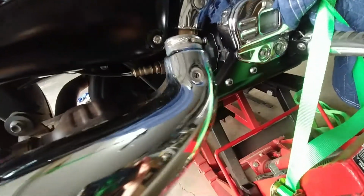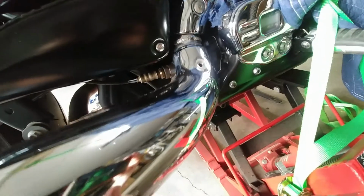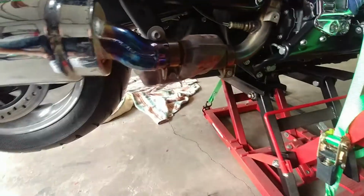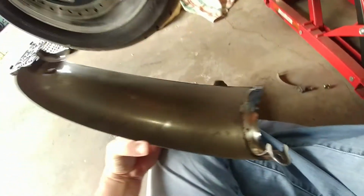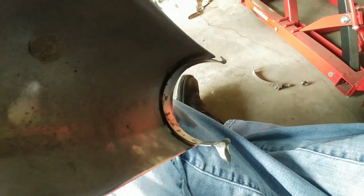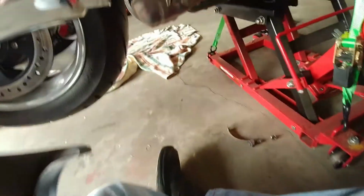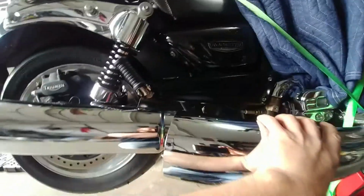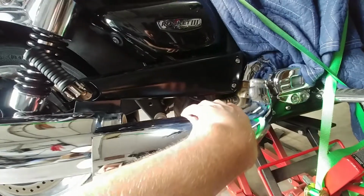It's noisy and squeaky, but the steps are you slide this tip underneath the chrome, right under here, underneath the existing piece of heat shield. And then I figured I'd want to show you guys this because it was a little confusing the first time. First things first, I said this in the other video, but this is the back side of the heat shield. You can see it's got a bit of a clamp to it here. That clamp just snaps over the smaller part of your muffler there. So let me get this back here. You just shove it over once you've got this piece in properly. This just snaps in place.